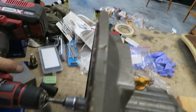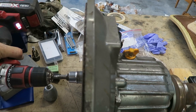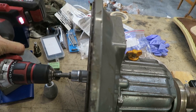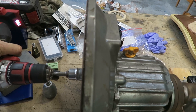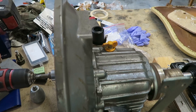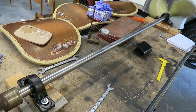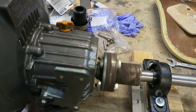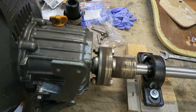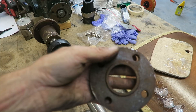Now that we're spinning the thing up, you can see the gearbox wriggling around — this is sort of what's causing the engine to move. So it's pretty much everything pointing to that little coupling in there and how it's bolting together. These things are machined from the factory to run true, so it's looking like the rust is the issue here.